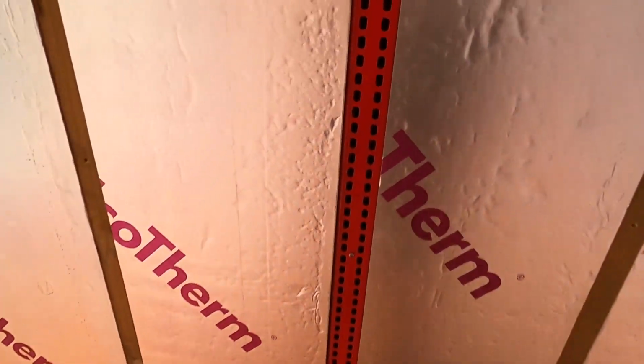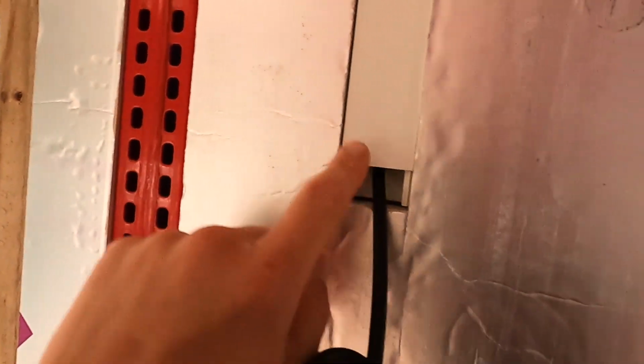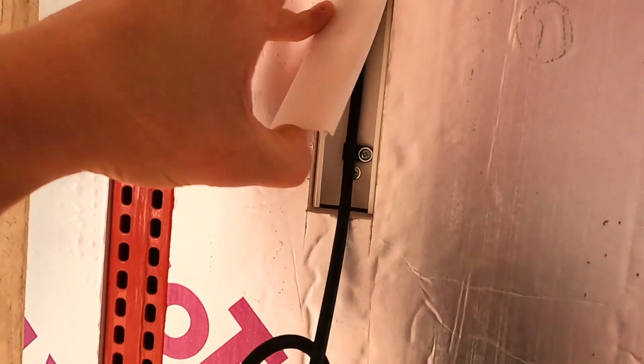What I want to do is do my best to fill up these metal supports with expanding foam. We've already rammed all these little cavities full with the recycled bottle insulation, and then all of these light trunkings, I'm going to be putting some in that as well. Reason being I haven't done that yet is purely because it's pretty straightforward to remove these covers and then fill it up with the bottle insulation. What I didn't want to do is put tension on the cables before we'd put all of the roof insulation in. But as you can see, there's some up there as well, so that'll get filled up.